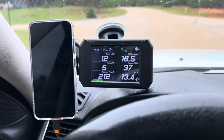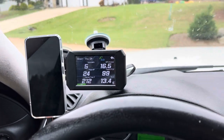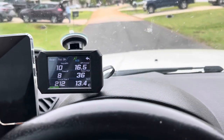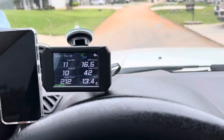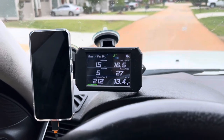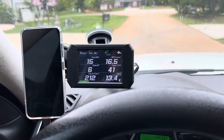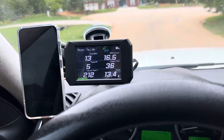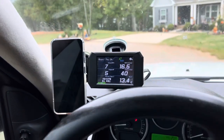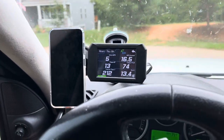I will be able to see it a lot more clearly whenever I change the radiator, the thermostat, and the overflow tank, and we're going to be using actual radiator fluid instead of this distilled water. And then I will test it again and see exactly what's happening, because fluctuations of temperature are normal. It allows water to circulate as things warm up. That's why the thermostat will open up and let water in. So I think right now it's nothing scary.